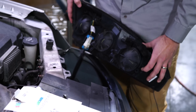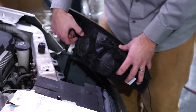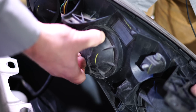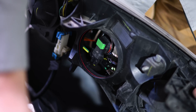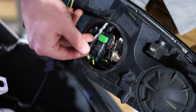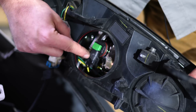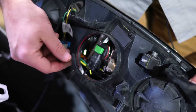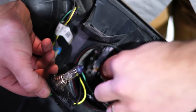We pulled out the headlight housing. For this car, we can leave this attached. We're going into the low beam cavity. This is the dust cap — you're going to unscrew that, it will twist. Pull out — it's just the cap. There's the bulb. We'll go ahead and untwist the bulb out of there and take the socket connector off. Some you may have to remove the socket connector first and then remove the bulb — it just depends on what bulb there is. We'll twist counterclockwise.